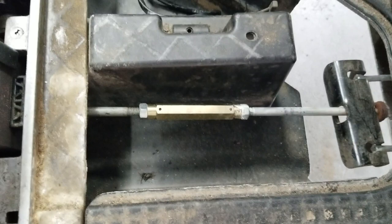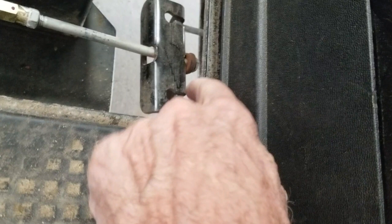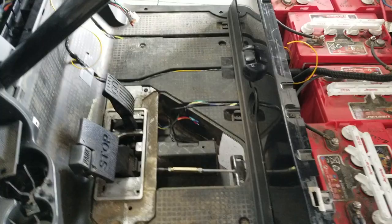The brake is adjusted perfectly. With the brakes off, put the tip of the tape measure on top of this, come up to the edge of this plastic floor — you want two inches from here to here. It's perfect, I got it at two inches. I lock the brake, and I'm trying to push the cart — it won't move because it's perfect. So that's the two-inch adjustment. Now I'm going to put the little panel back in the floor, put the mat down, and screw it down.